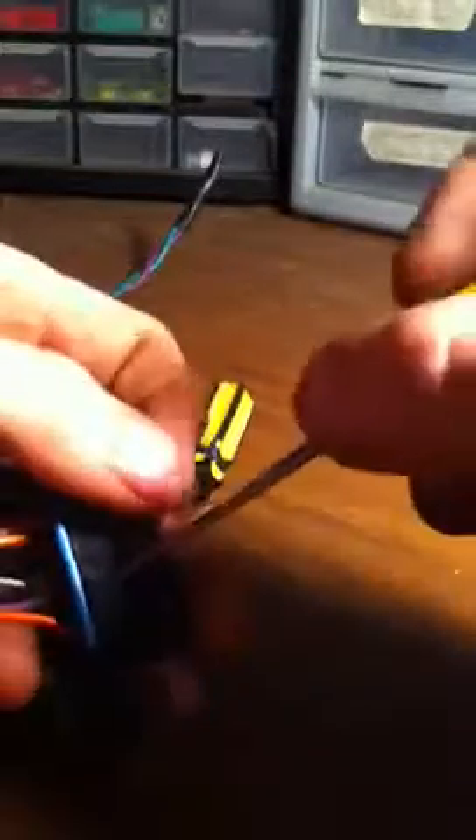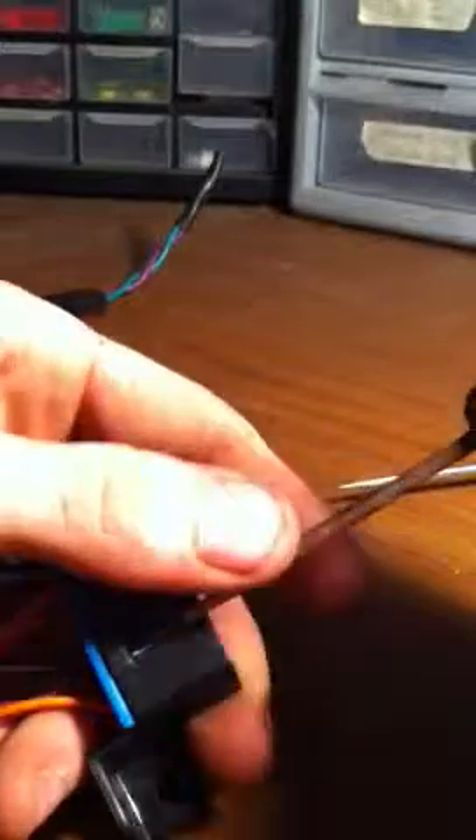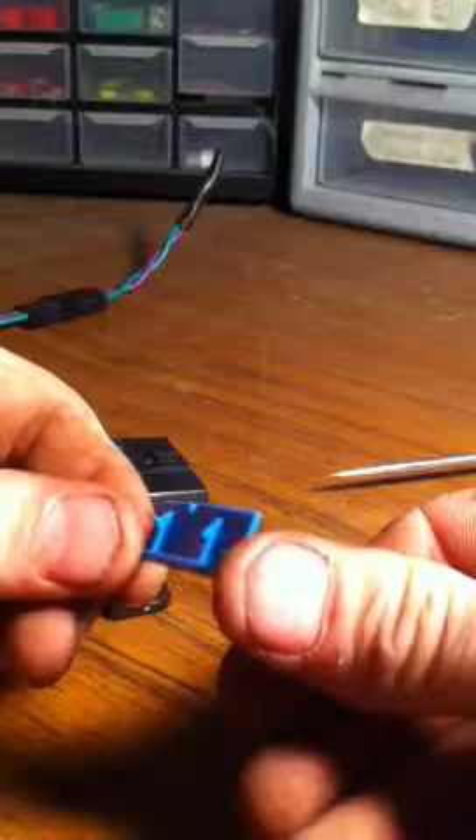We're not using special tools — we're using picks and a couple other things I'll show you that help out with automotive electrical work. This one's got a little bent tip. I'm going to insert it in the back side, push it down, then use a flat-tip screwdriver to pull it out. Same thing on this side — you're just kind of prying up to push it down a little bit and it'll pop right out. See, it's just little tabs — got that one a little bit bent, but it's okay.